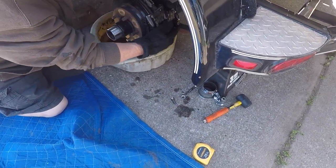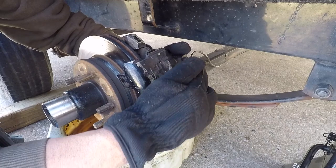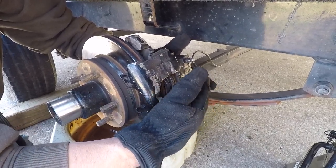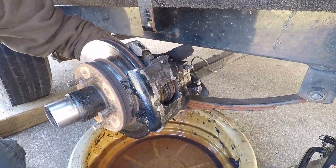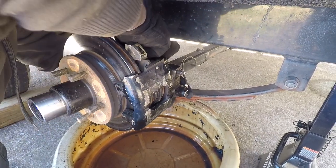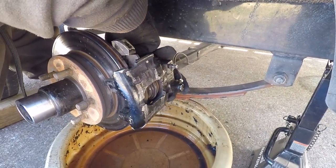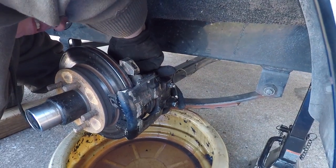So this is a banjo. They call it a banjo nut. So this should just come off, so we don't have to mess with that 3/8 fitting. Maybe we can just take the banjo bolt out and then drain down in the pan. Hopefully. Otherwise, I gotta try to put this bolt back in for a few threads, which I might do anyway, just because I gotta have something to grab a hold of. Hopefully it'll come undone. I soaked them with PB Blaster overnight. A lot of times that just doesn't do anything, but hoping. So anyway, that's what we got going on.